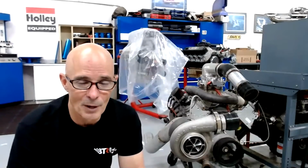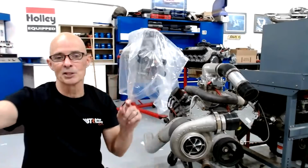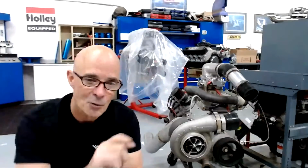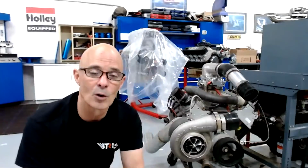Yeah, and then we run a separate line from the intake to the blow-off valve. But they're all getting the same reference. It's all from the intake manifold. But we try to separate them. This one's taking from over here, so it doesn't hear any of the interference that's going on over here with our little manual bleed valve or our 3-port deal for the TC1.